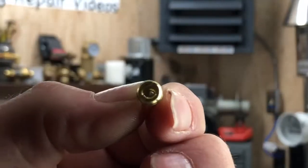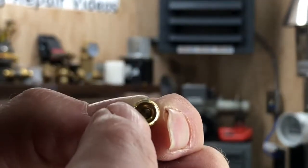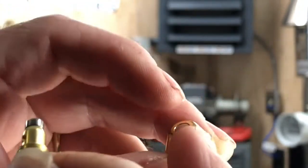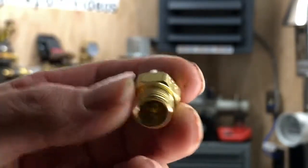The very center of this is plugged — it kind of has a little lip on it. The fuel goes right through the center of this little plug and comes out of this little circle hole here, then it's going through this little hole and then out into the combustion chamber.